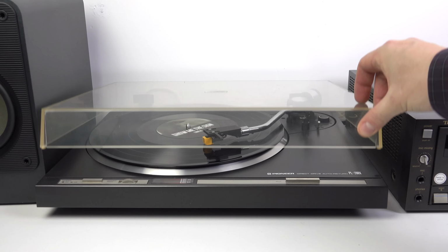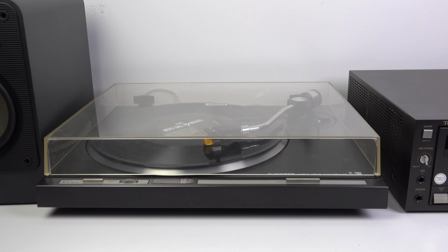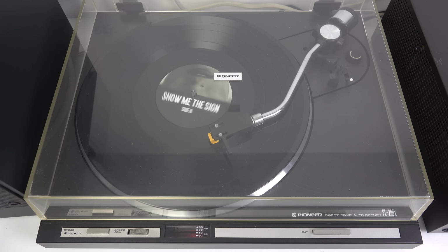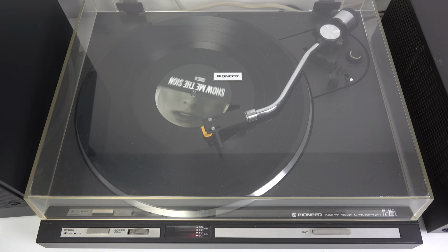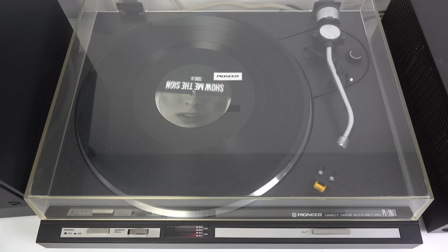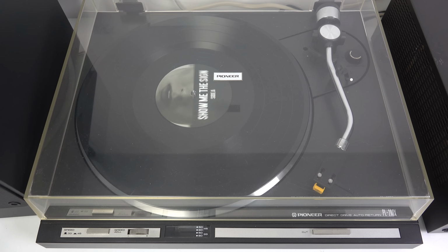The only thing that I think is a little bit unusual or odd about this record player is the fact that there's no on-off button on it. Well, it's unusual to me, as all my other record players have an on-off switch. The buttons you see on this, well, the bottom right is labelled cut. When you press that, it lifts the arm off the record, it moves back to the rest position, and the device shuts down. The bottom left button, that's the speed between 33 and 45, and next to that is the fine speed adjustment wheel. So yes, to start this device up or turn it on, all you do is lift the arm up above the platter and it will then automatically start spinning. But yeah, there's no separate power switch.